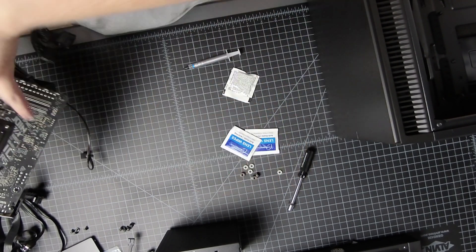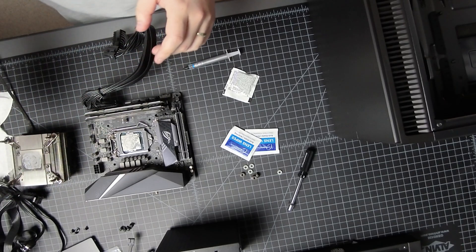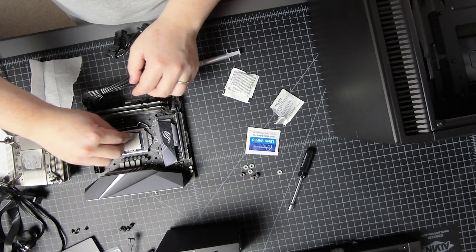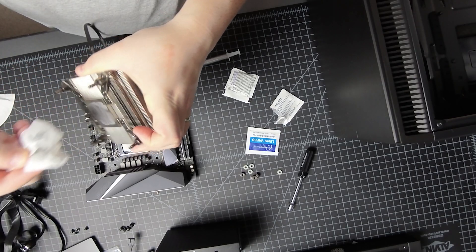Time to get the CPU cooler off, clean the CPU, and then mount the new cooler on it. For anyone attempting to clean out their CPU, you can use alcohol wipes and a coffee filter — that will do the trick. Thermal paste was applied there, so I just need to replace that. I'm going to clean out the CPU first, use the coffee filter to wipe off any residue, and use the same wipe on nearby areas too. I'm also just going to wipe down some other areas of the motherboard that have collected some dust.